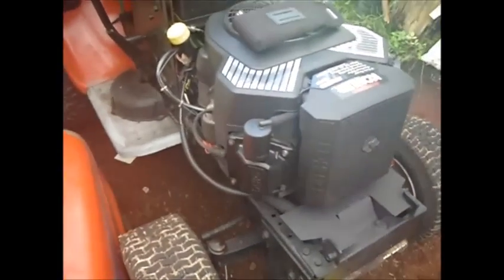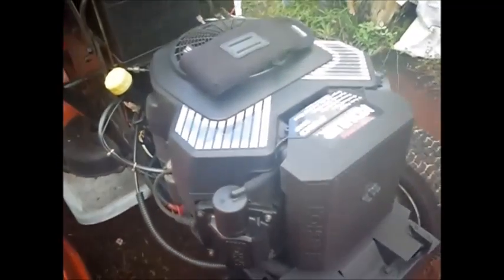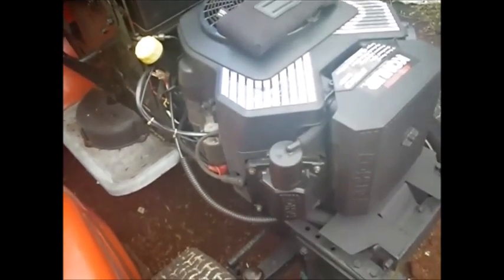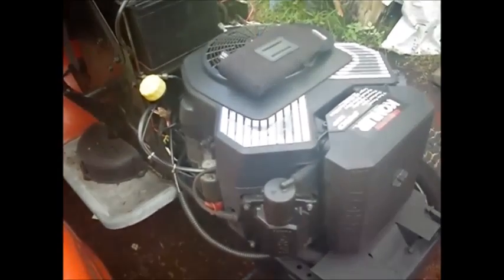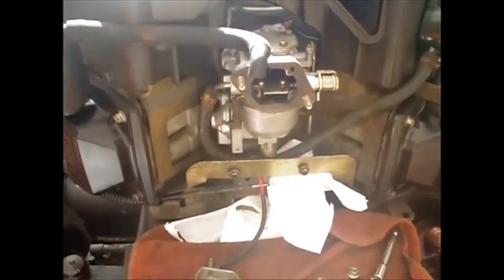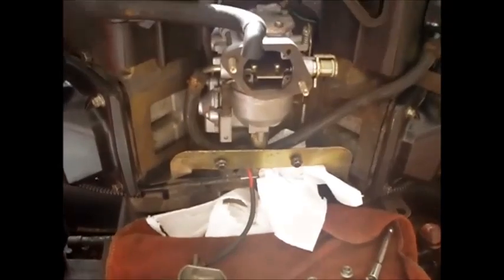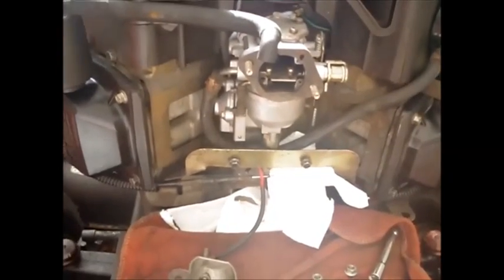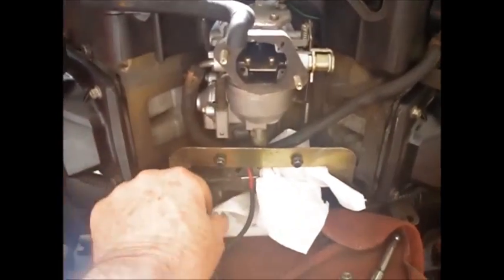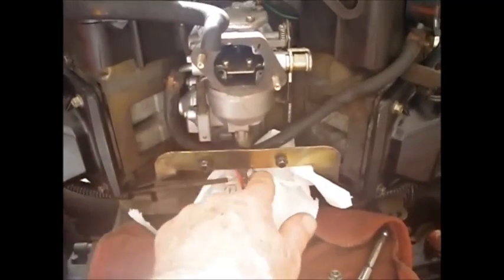Okay, so now it's back together. I just got to start it - I want to put the mower deck back on before I start it though. I also had to repair and re-route the wire on the electric clutch so I want to make sure it's clear of everything. The initial start - it was not getting full throttle. It would start easy and idle but nothing past mid-throttle to full throttle, so I'm going to take the carburetor off and see if there's anything gummed up on it first before I start looking at other things.